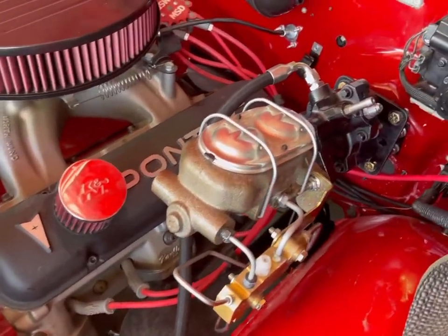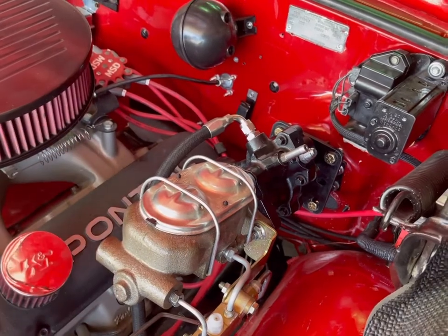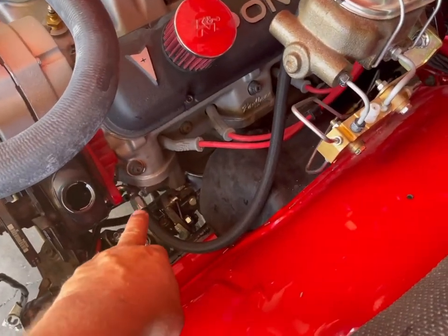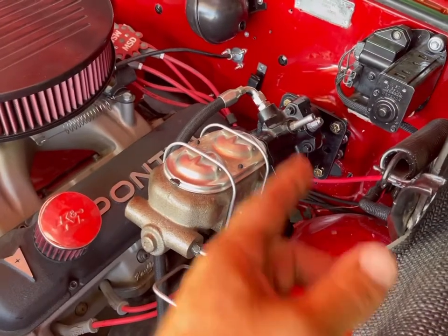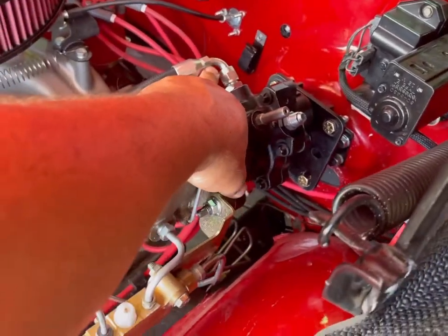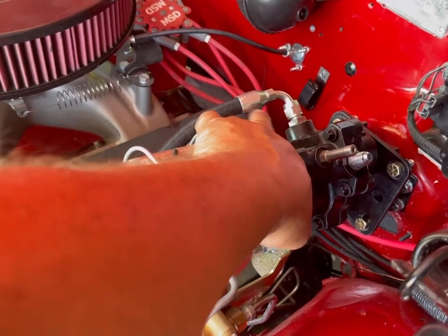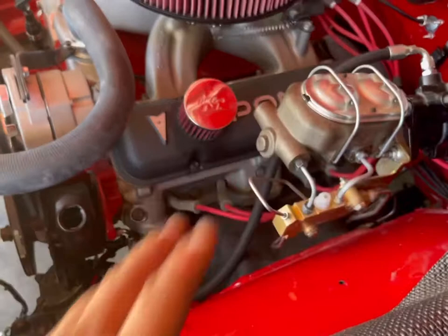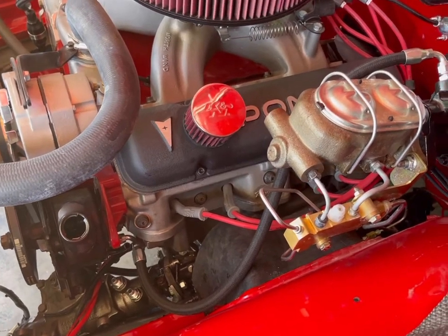It looks pretty good. One thing that I didn't expect to be an issue, and it was a pretty big issue, is these 90 degree fittings. This hose doesn't twist. If you try to twist it, it rolls up like you're trying to make a spiral. So when I measured this hose, I didn't take into account that that 90 needs to be pointed. Once it's all assembled, it has to be pointed in a certain direction. And I guess what I'm going to have to do on the next one is mark on each side of this connection of these two pieces, so that when I screw this one on, that mark is aiming in the right direction. That's the only thing I could think of, because I had to pretty much take this end back apart and clock it and fiddle with it, and I pray it don't leak, but I did not take that into account.